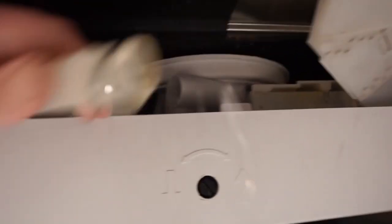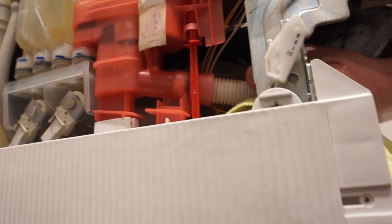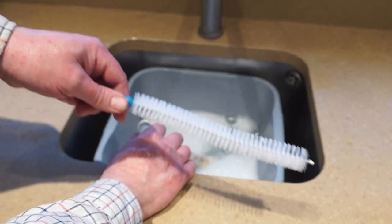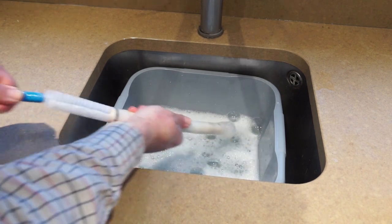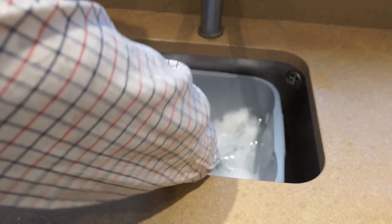What you may find is that the hose was blocked — on my machine the hose was blocked though the chamber wasn't too bad. There is a bit of water still in the machine, so I've got a tray down just hoping not too much spills. I'll pop that off — just a little bit of water came out there, that's fine. Moving around, I've got a cloth ready, and I'm just going to pull that hose out. Now we've got the hose out and there it is.